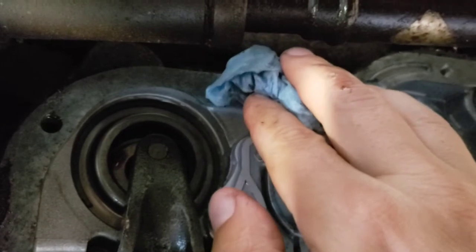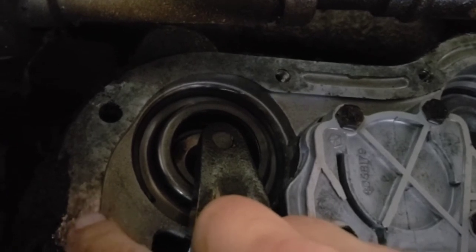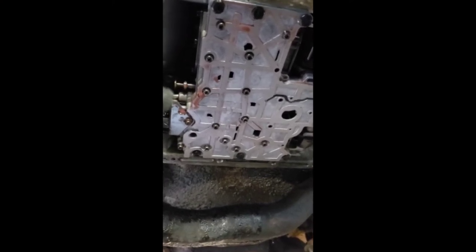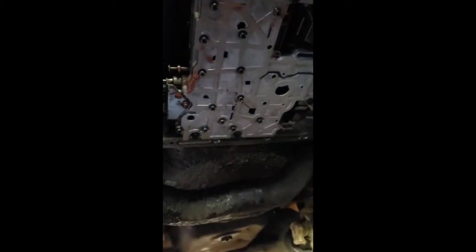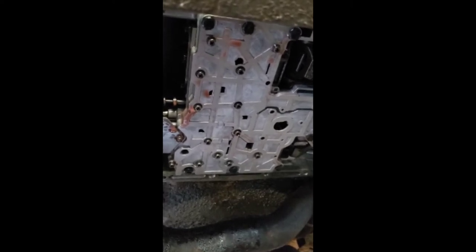Make sure you clean up the sides with a rag and degreaser. If you have to, I'm going to need to use a putty knife or a paint scraper or something to get the rest of this grease off and then degrease it. Using air, I knocked out some more watery, terrible transmission fluid. Be patient with this procedure — you want all that crap out of there, whether you're flushing your system or getting watery transmission fluid out like I am.